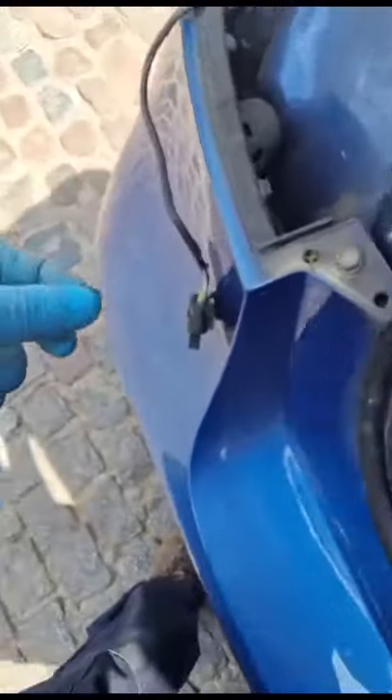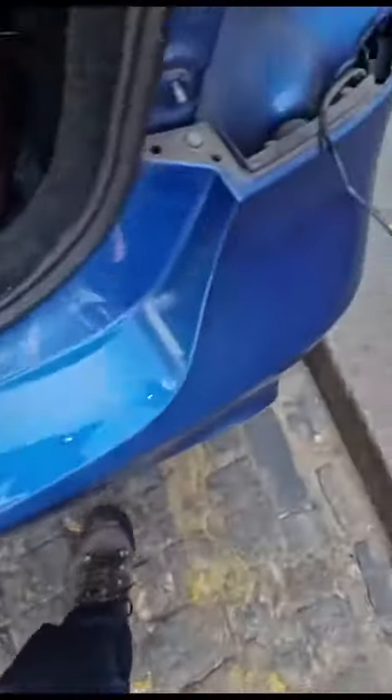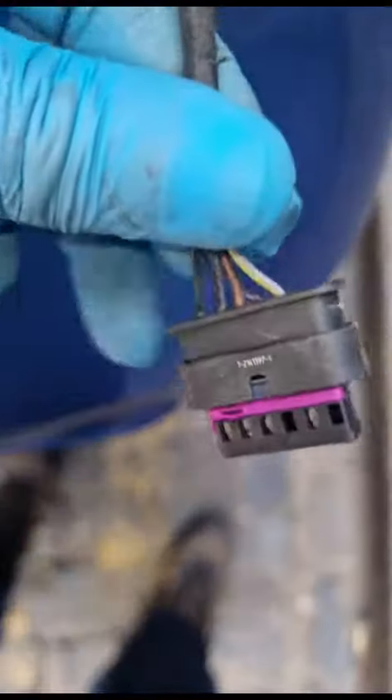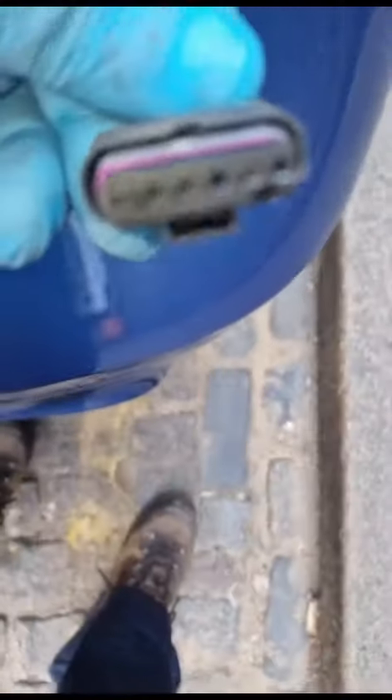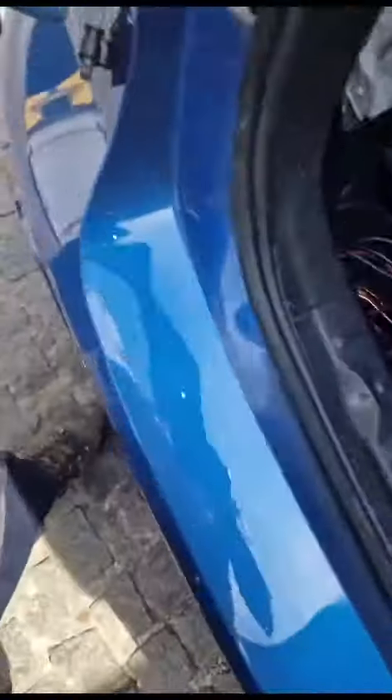Confirmation of the problem: look at these connectors. Even though they've done the repair, the pins are not coming up. You're looking for the silver pins on this connector. I know this because I've taken off the other side - you can see the silver pins come up inside the connector on the right hand side, but there's nothing on the left hand side.